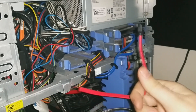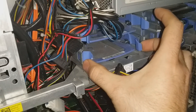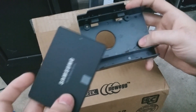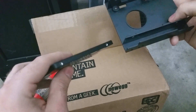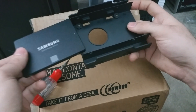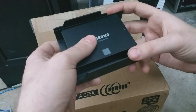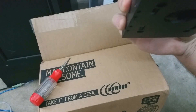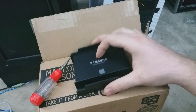Next, we'll install the SSD in one of these bays up here. I'm going to set up the SSD in the bracket outside of the machine. Interestingly, it seems like there are two places you can install the SSD on this adapter — screw holes on the bottom and screw holes on the side. You can actually install two drives in this adapter, but I just need it for one. I'll put it this way to allow a bit more air circulation underneath.